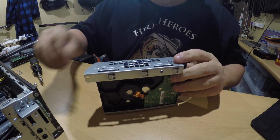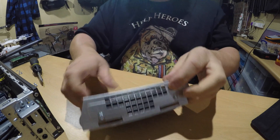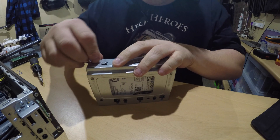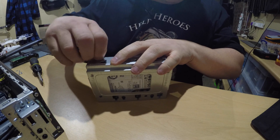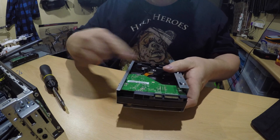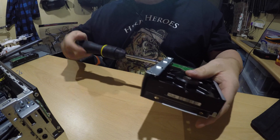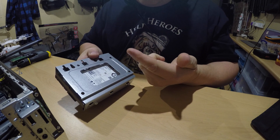I'm going to put them in just hand-tight quickly. Get them all lined up on the left side and move them into place. Four screws normally hold the hard drive in, so make sure you put all four screws back — because if you move your PC around, it's not going to dangle or make noise. Make sure you put it in the right way as well, otherwise you'll find your drive is upside down. Just nice and hand tight — it only has to be hand tight. Now if you look at the drive, the label is facing upwards as I mentioned.